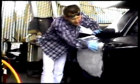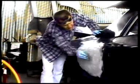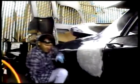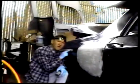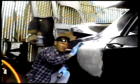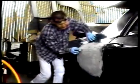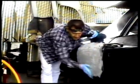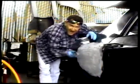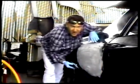Stay along the character lines and just shape it. What you want to do is line it up with this panel and this panel so it's straight. You always feel to make sure that it's flat. The flatter it is, the better the paint's going to look.